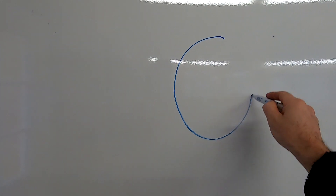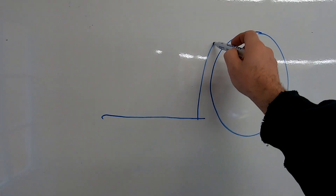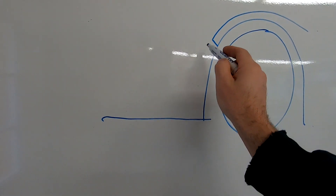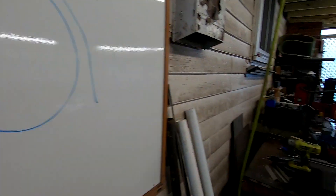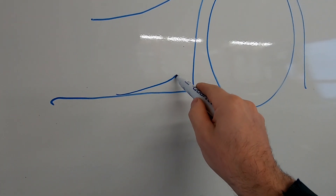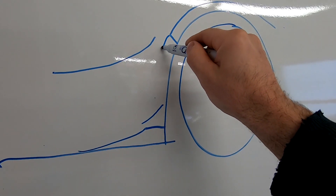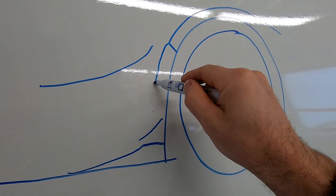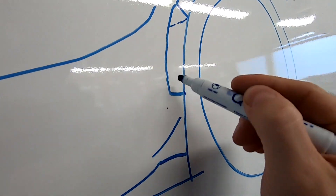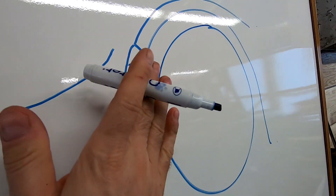Now that I took the measurements of my car — let's say this is the wheel, here's the splitter, the wheel well, and I have a flare that kind of comes up this way. The canard shoots right above it. And then I have that outer tunnel that goes about here, and that flap right there. The duct is going to come down probably something like this, and we're going to channel the air through the duct out just outboard of the tire.